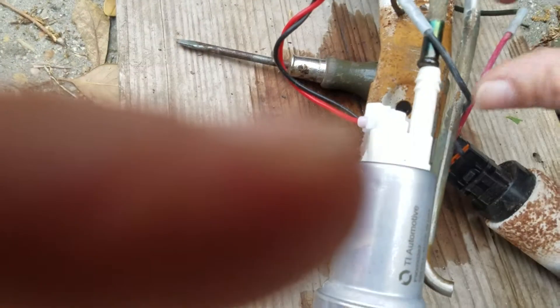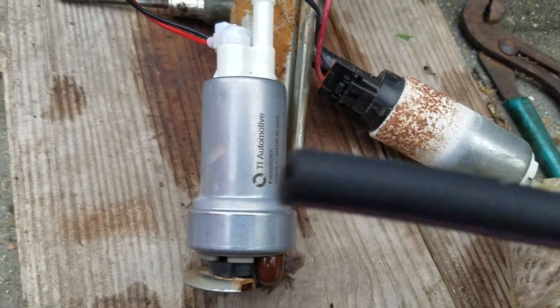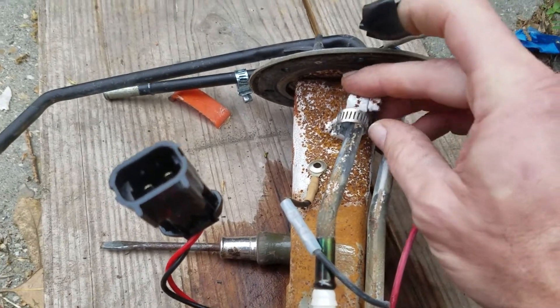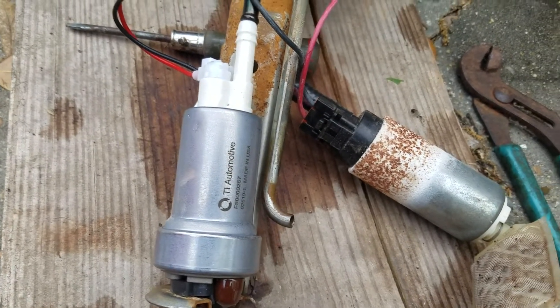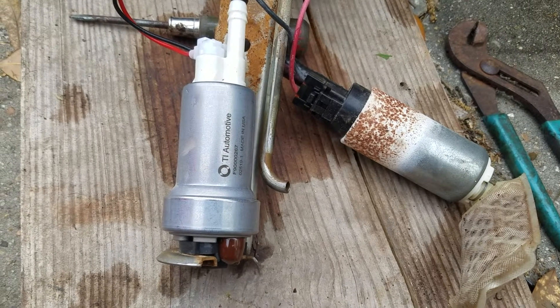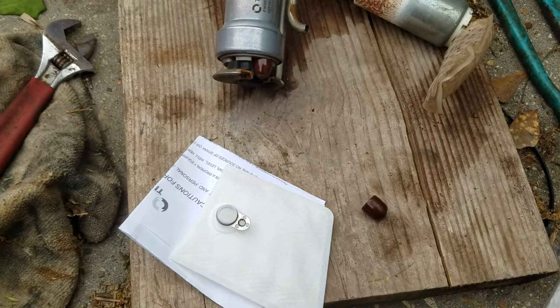These are just butted right up against each other, so the hose they provided — which is about two extra feet longer than I need — I'm gonna have to chop it and put some clamps on it. I really don't feel good about using those crappy old clamps that already rusted. It's important to note here in the gulf south with all the salt air — there is no such thing as stainless steel. Every stainless steel I've bought for this car has already rusted in some way, which is kind of a disappointment.